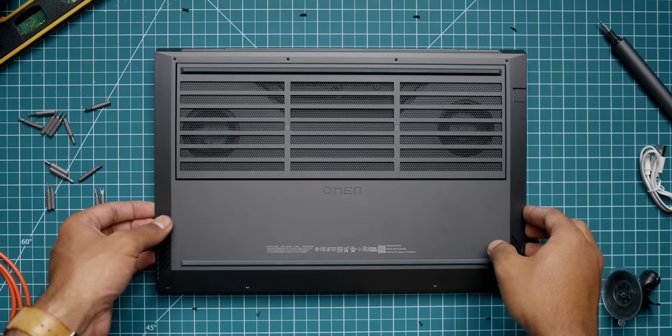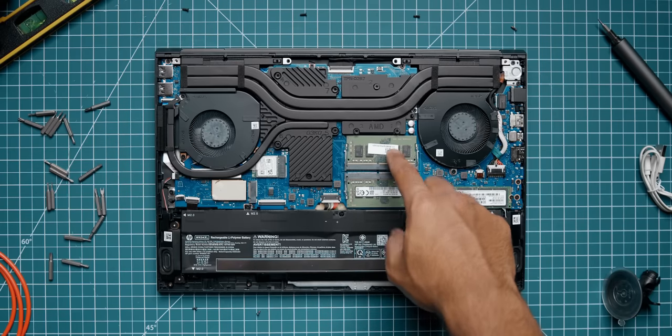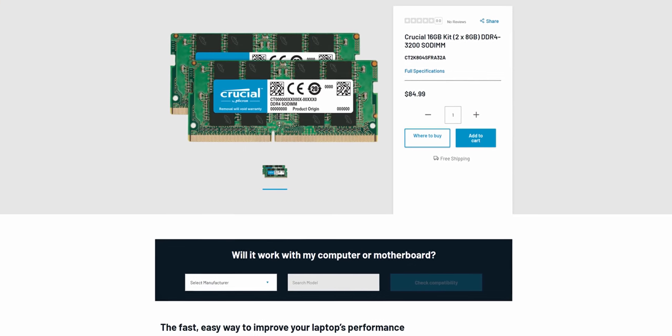So what can you do about this? First, educate yourself about the memory in your laptop to see if there's performance being left on the table. In the OMEN 16's case, HP equipped it with a good kit, but other laptops might not be so lucky. The only solution is to upgrade the memory with a kit that runs at tighter secondary timings. Luckily, most gaming laptop manufacturers like OMEN have easy access to memory by just unscrewing the bottom cover and replacing the modules. Just watch out since some laptops now come with one bank of memory soldered into place, which is really frustrating. Look for a kit that runs natively at whatever speed your laptop's original memory runs at, and one that doesn't need XMP to hit its frequency. Since there's usually no listing of secondary timings, do a bit of research on forums like Reddit to see what people are recommending. Right now your best bet is to pick up standard OEM modules from Crucial since they run at great all-around timings — though that could change if they roll out ones with slower secondary timings.